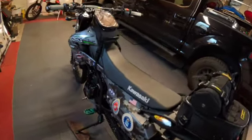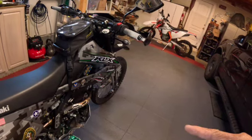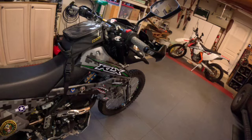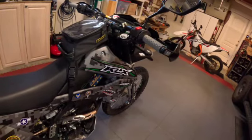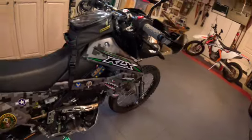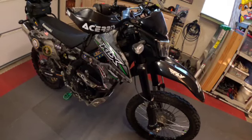On the highway, it's getting to its limit, but with the EJK, it's almost as if it gave it another gear. It revs higher and still pulls at the upper RPM. So around 65, I'm at 8,000 RPMs right now, which prior to the EJK, it was getting pretty close to maxed out at the speed limit.